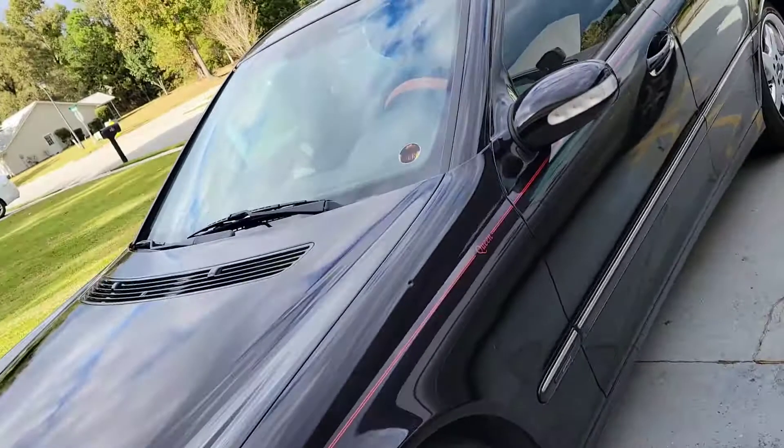Automatically I knew I had a short. So what I began doing is I took the taillights out, looking for frayed wires around the taillights and the license lights up here. I took those out. I even had the whole panel on the hatchback off and I was looking at the bulbs up front.